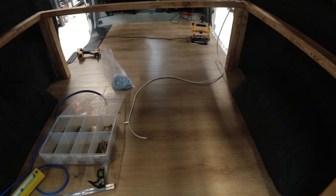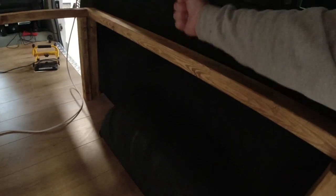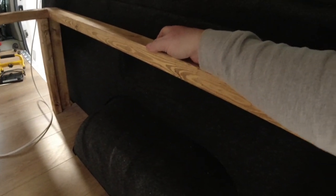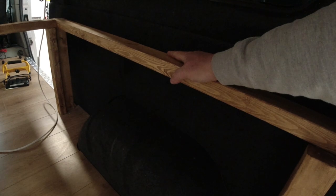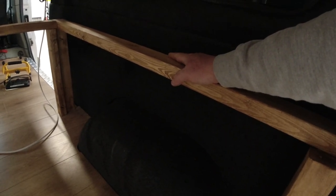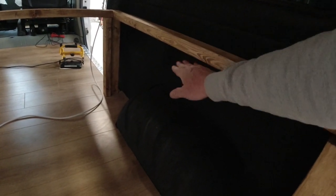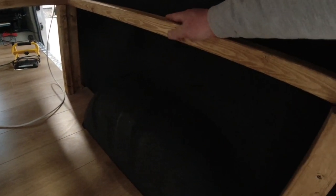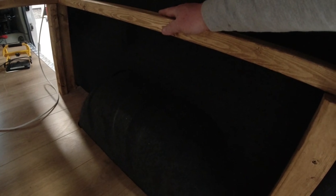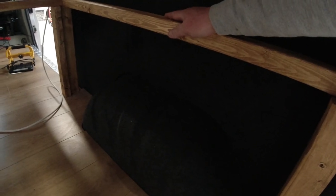What I really need to do now is fit a support here, although it doesn't need one. In fact I'm not going to put one there at all — it won't need one by the time the slats are across the bed as well. It definitely won't need a support. So now what I need to do is scribe a template to go in there on both sides, as this is where the slats are going to sit. I'm going to make that out of cardboard and then cut it out of thin ply, just so I know it's perfect.